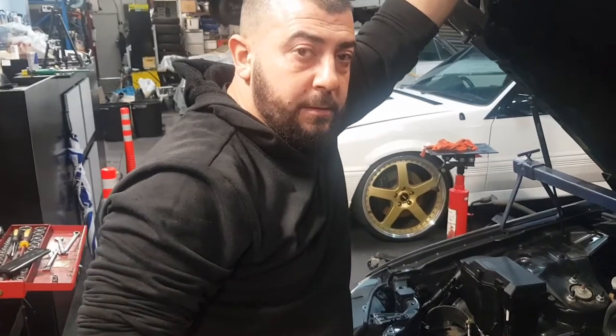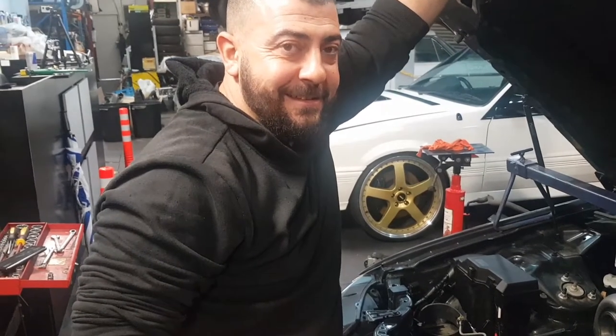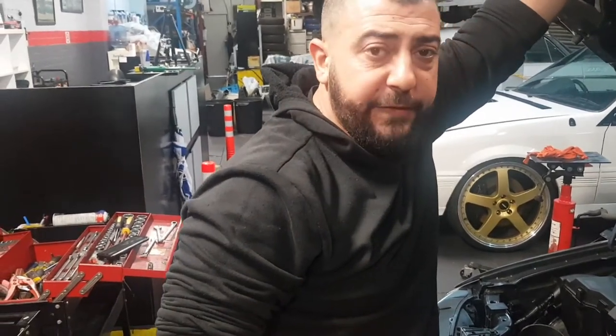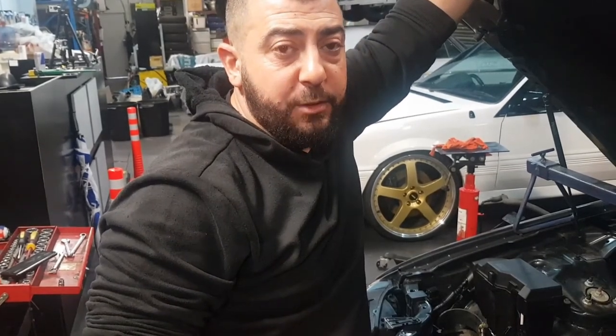So Youssef, it's Sunday. There's about 300 millimetres of water outside, but you're dedicated to the cause, mate. What stage are we currently up to? We're just bracing the engine, about to drop the sump so we can pull the timing cover off and the oil pump. And then we can go ahead and pull the cams and do the valve springs and what have you.